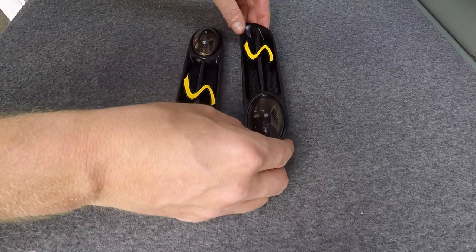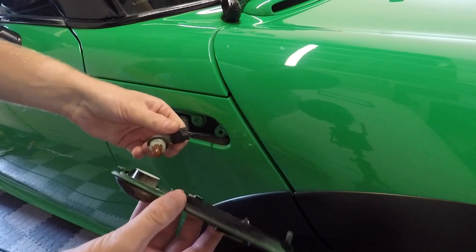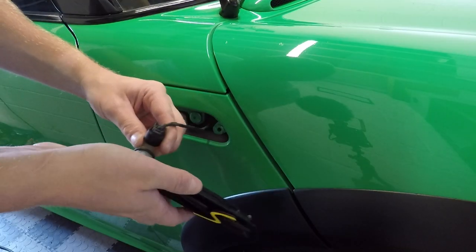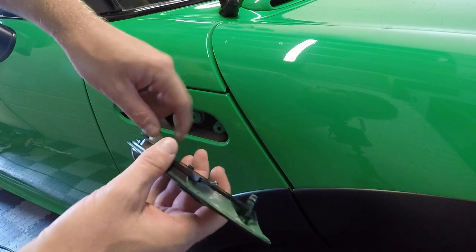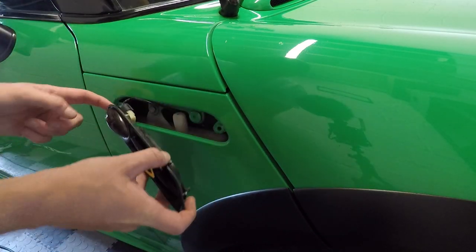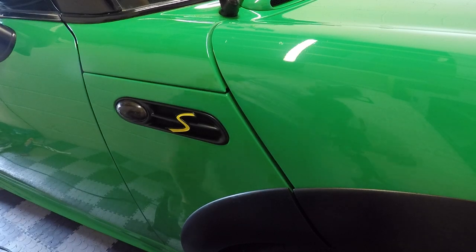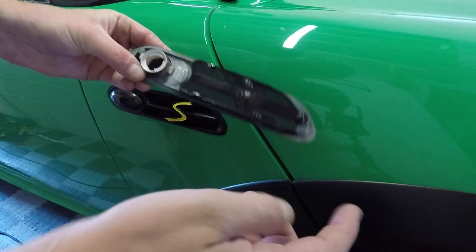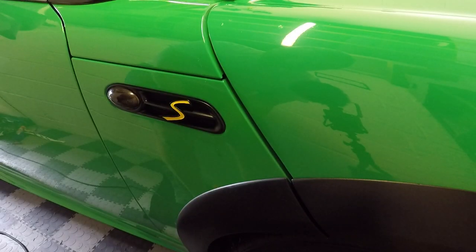Back to the car — it's so simple to refit these. With your bulb holder left on, bulb in place, hook the hook on the back edge, push it in place. Repeat the process on the other side. Remember: the prong pushes in at the front edge and the hook hooks on the back edge — it's as simple as that. If you like what you saw, feel free to hit the like button and subscribe to the channel — that really supports us and we'd appreciate it.